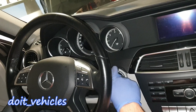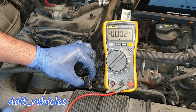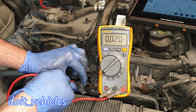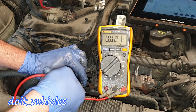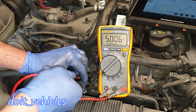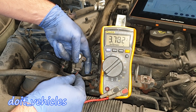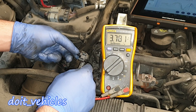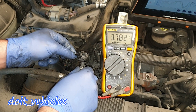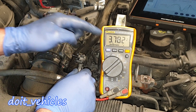Now let's prepare the voltmeter. I'm connecting the black terminal to ground. Let's also put the car battery on charge. Holding the connector, I'll start with pin number 1 — we've got nothing. We need to find the pin with 5 volts, and this is the one: pin number 3 has 5 volts. I'll reconnect the sensor. The middle pin is the signal wire — we've got 3.7 volts. If I increase the pressure the voltage will increase, and if I decrease the pressure the voltage will decrease.